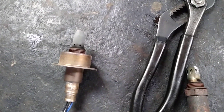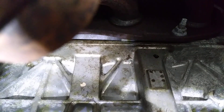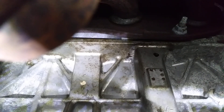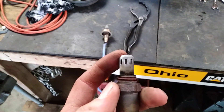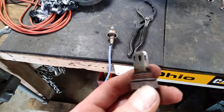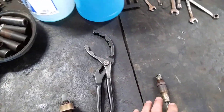I'll show you the oil situation at the exhaust manifold. I wouldn't really say it's leaking oil at the exhaust manifold — I guess I misworded that — but according to the diagrams I'm reading, the white deposits are caused by burning oil.